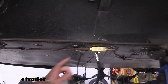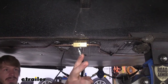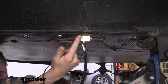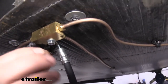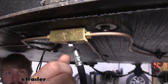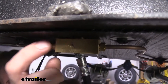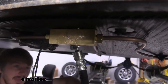This is our first union from the kit — the four-way union. You'll have two multi-tap unions in the kit. This one has four ports: one on this side, one on the other side, and two on this side here. We use the included self-tapper to run it right up into the I-beam. I did stack a couple of washers on top just to space it down a little bit — it makes it easier to get your wrench on the lines to tighten them down. I recommend it because it can be difficult to tighten these lines if the union is straight up against the bottom of the I-beam.